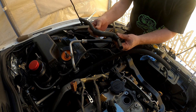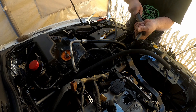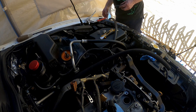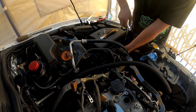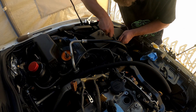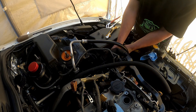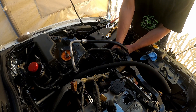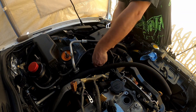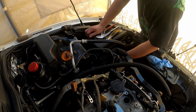This hose has got this protector on it. I'm going to take this protector off, slide it onto there, and then position it in a nice location. She's cracked anyway — look at that, needed replacing. I want a little bit of slop, but not too much. The protector goes on really easy — or does it? Spoke too soon — it doesn't go on that easy. Probably should have put some silicone spray on it. It's a 9.5 mil tube on 11 mil pipe, so it isn't easy to get on.